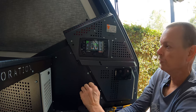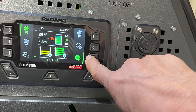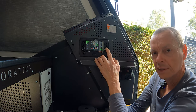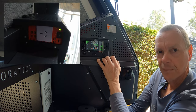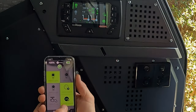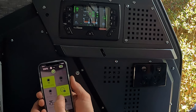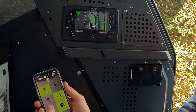We've connected the 2000 watt inverter to a TVMS channel called '240 volts' using the regular Redarc remote control function. That meant disconnecting the integral 350 watt inverter from the data feed and instead connecting it as a digital output of the distribution box, with its own soft key, so we can now control both inverters from the TVMS screen. We can also control them both from our telephone via the app — so if we lock the T-Van and realise we've left the inverters on, we can easily shut them off on our phone.